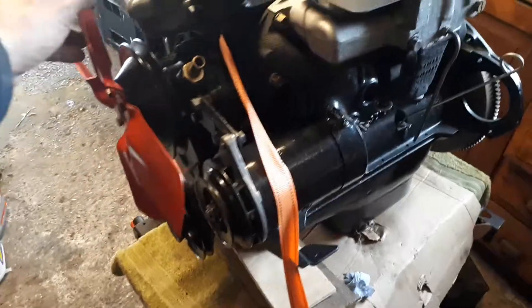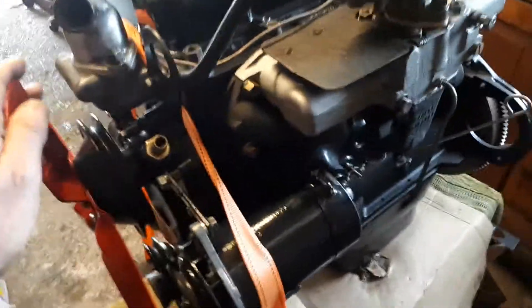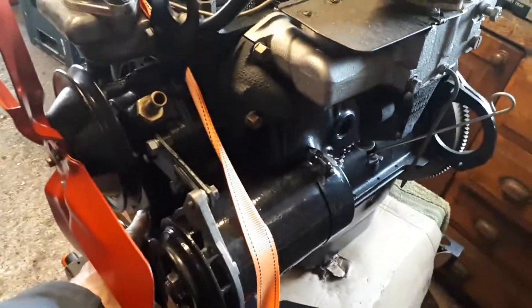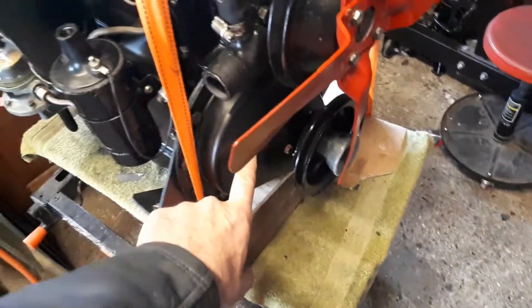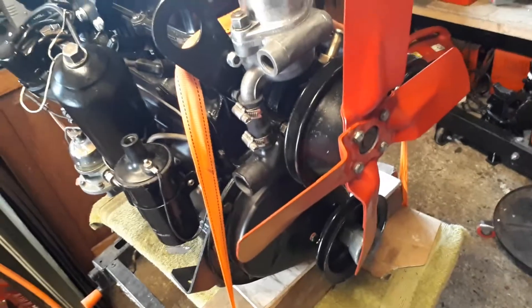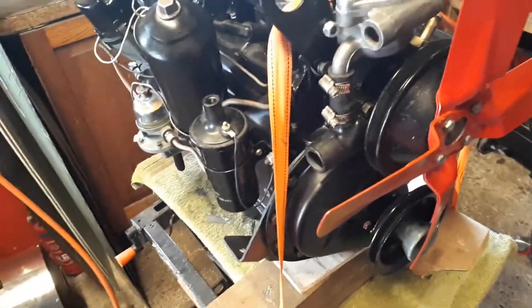I have put another video on regarding the camshaft timing — it's always quite interesting. There's a common fault where people tend to get it 180 degrees out, simply assuming the two dots that line up on the cam and the crank underneath the timing chain are lined up for number one cylinder, whereas in fact they're lined up for number four cylinder.